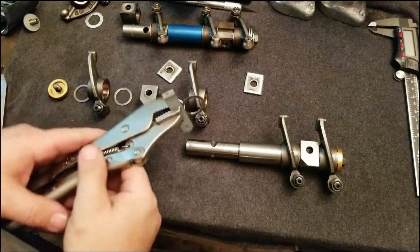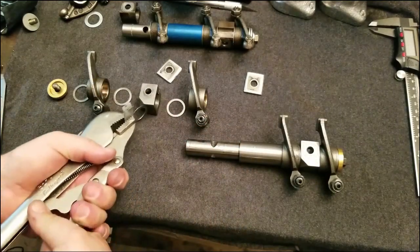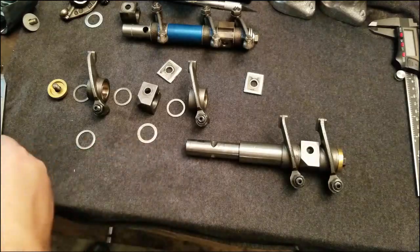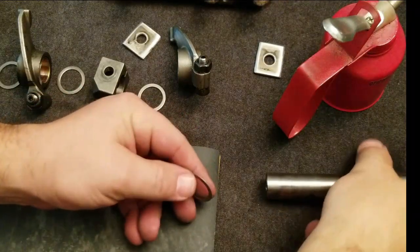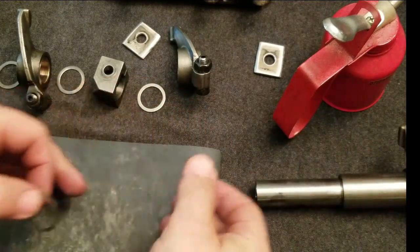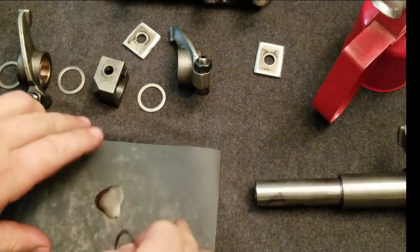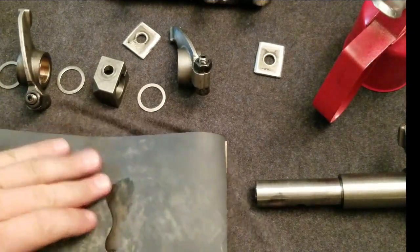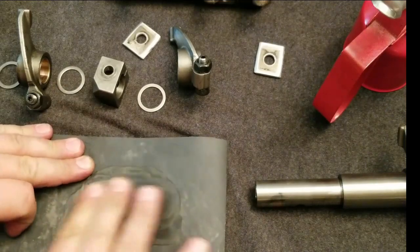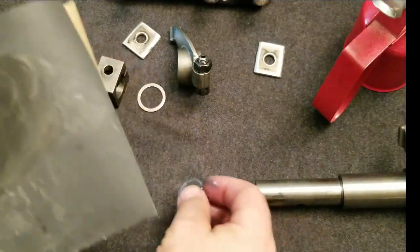Now I'm also going to take some sandpaper, 400, 500 grit, and run it over that with some oil before I put it on here, because it's got some burrs on it now. All right, guys, we're good. She's fitting now. I'm hoping it's the right size to do what I wanted to do, but first off, this is 500 grit, a little bit of oil. I'm just going to run around and deburr it some. Do the outside, and then we will roll it.